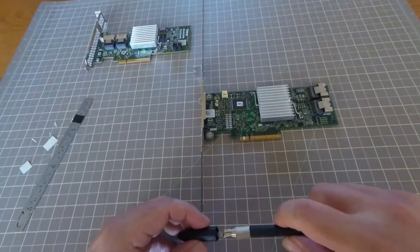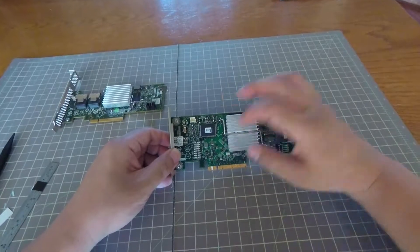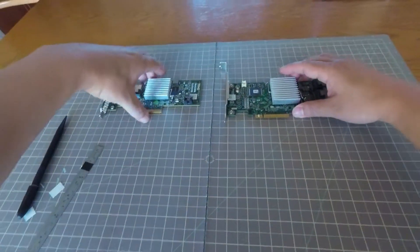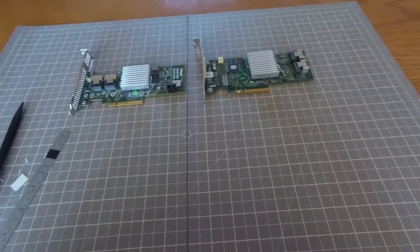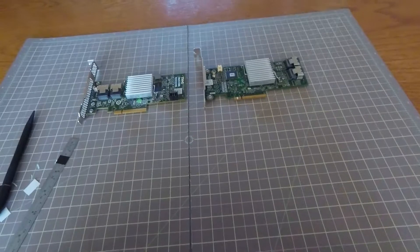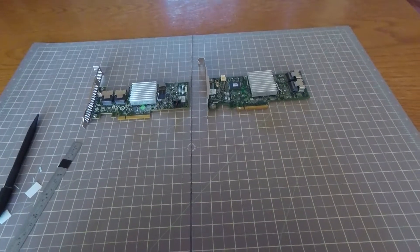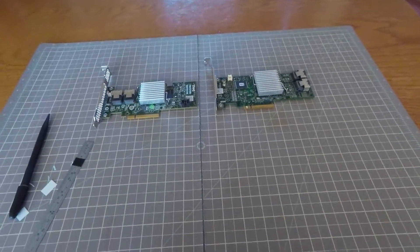And that's it. That's all you have to do if you're having problems with these Dell cards in a non-Dell machine — apply a little bit of tape like that, put this card back in, and it should just work just fine. Hopefully that helps anybody who's having this problem. I have a store on eBay called The Art of Server where I sell these cards and other IT mode HBA cards already flashed. If you need anything like that, please check out my eBay store — I'll leave a link in the description. Thank you very much, bye-bye.